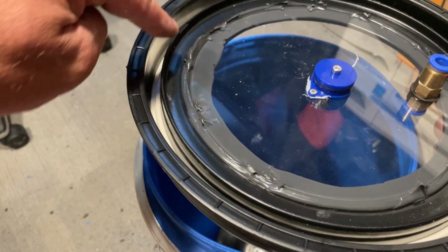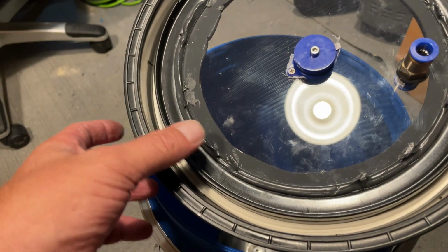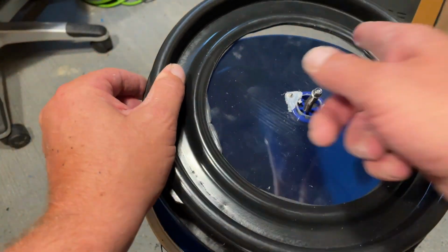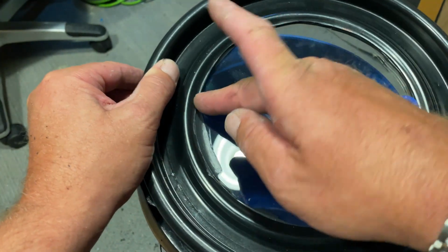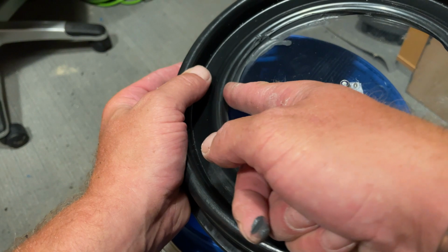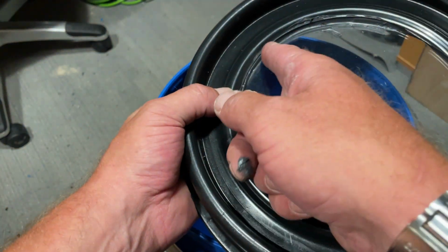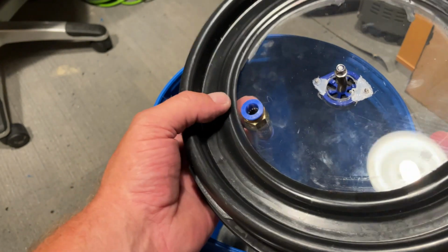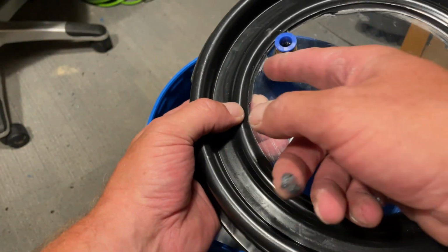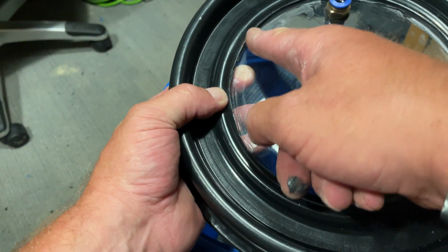You've got that little overlap or overrun of CT1 that I was talking about, and you can, if you wish, obviously work that into the lid just to get a bit of extra tack. Me personally, not bothered. And you can, as I say, finger point it around the edges. Squeeze a bit more, just to create that nice little seal from the outside edge. There's a limit of where you can go up to with that airline set up there. Don't worry about any overspill or finger marks with CT1.